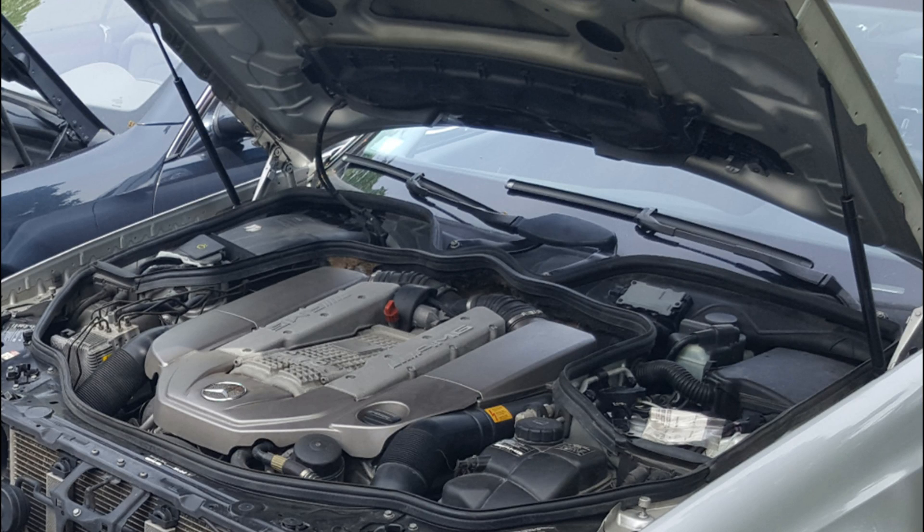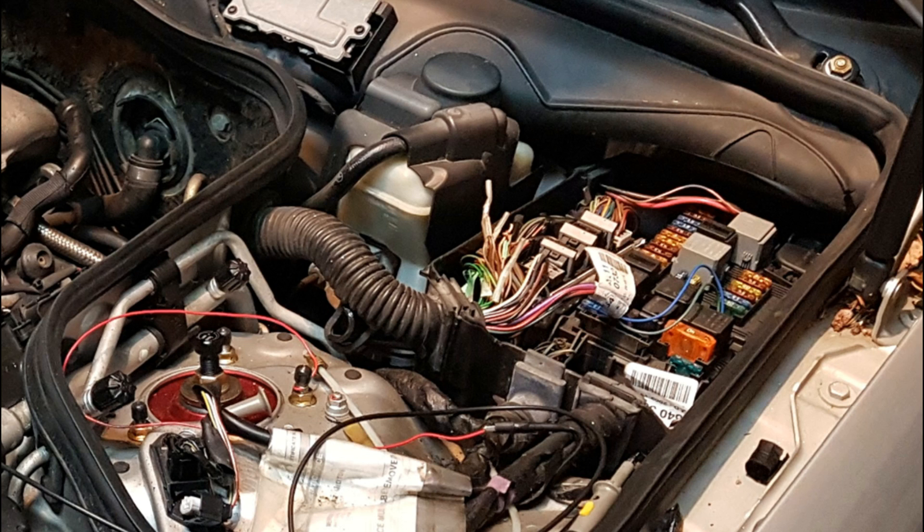Once you've sorted all the wires, the next step is to find the location of your ECU — your engine control unit, sometimes also called ECM. For me it was located under a plastic cover in the engine bay, but for some other cars it might be located inside the car. Once you remove the cover, there's a fuse box on one side and the ECU on the other side. The wires coming out of the ECU going to the engine are the ones going to your injectors, sensors, and everything — those are the wires you need to tap into. Before tapping any wires, I highly recommend disconnecting the negative terminal on your battery and removing the plugs from your ECU, because when you're cutting so many wires and making so many connections, it is easy to make mistakes.